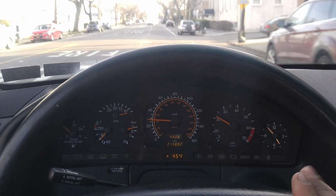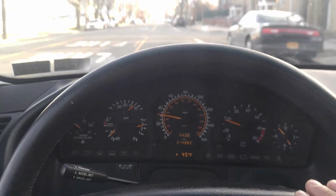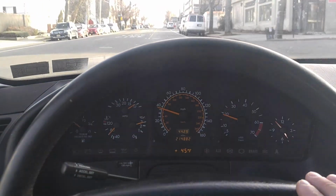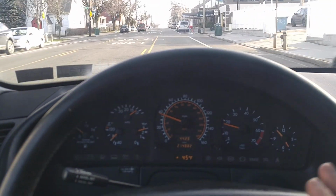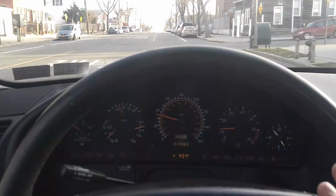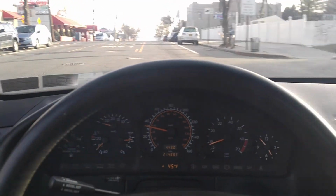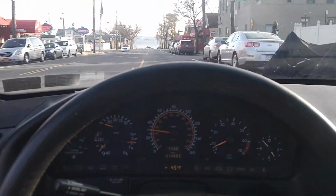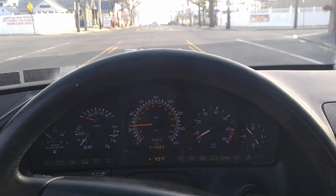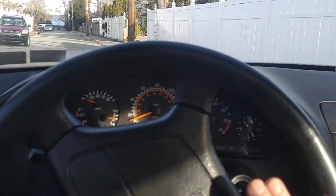Normal RPMs, for example, for this car I'm driving, this 92 500 SEL: the normal idle RPM when I'm just at the red light or just parked, obviously in gear, in reverse, let's say, or in drive at the red light with the brake pedal depressed, would be about 525, whereas the SL500 would be around 490 to 500 RPMs. It's just the way it is. So it's normal that you can see RPMs being that low.